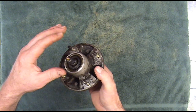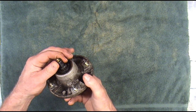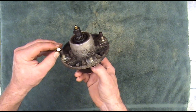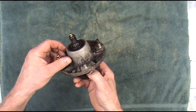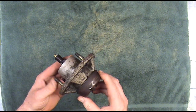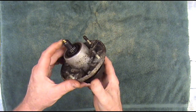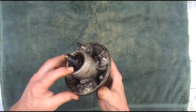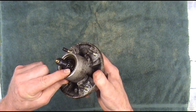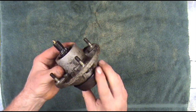There are only four nuts and the spindle just drops down off the deck. You'll have to take the pulley off for it to clear. The spindle goes up from the bottom with four nuts that hold it on. It's real easy to take off, so I didn't see any point in adding that to the video. The problem I have with this spindle is the grease never gets to the bearing. It's got a hole right here in the side of the shaft and the grease comes right back out the top — it never even gets to the bearing.